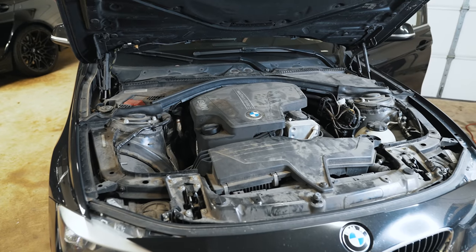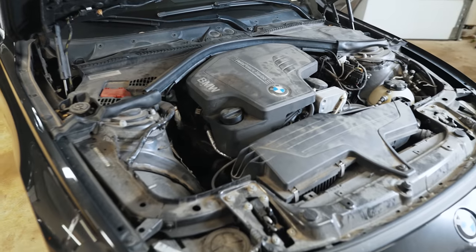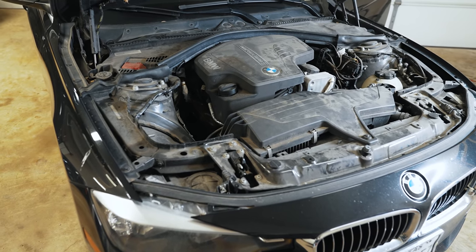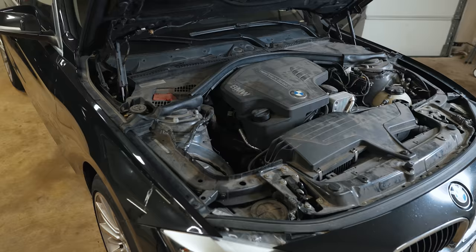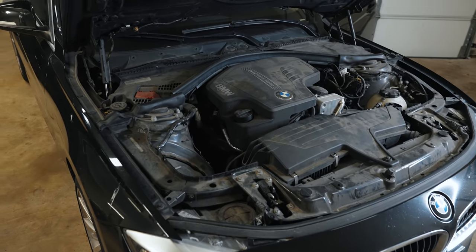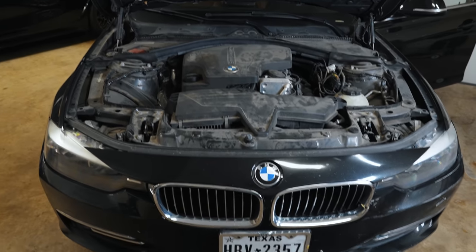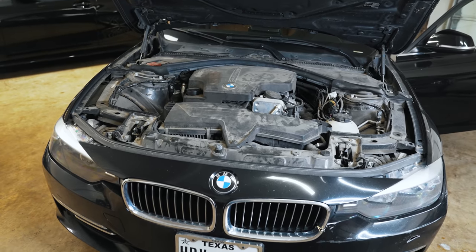So that wasn't very hard to make out. You got a drivetrain malfunction. I think when the car is trying to adjust valve timing, it realizes that it's way out of whack and the chain loses tension, and that's when you get that. Then it tries to just lock the cams and gets a little bit quieter to regain some tension on that chain. If you were to shut it off while it's making that terrible racket, then the chain would be loose. If you shut it off after it adapts with the drivetrain malfunction, it tightens itself back up. So it probably has to do with valve timing and potentially low oil pressure.